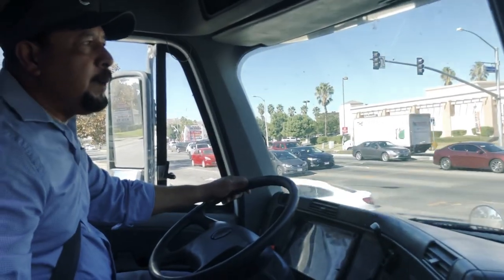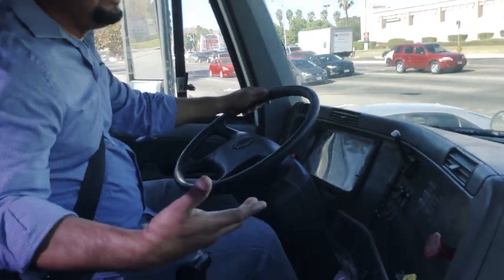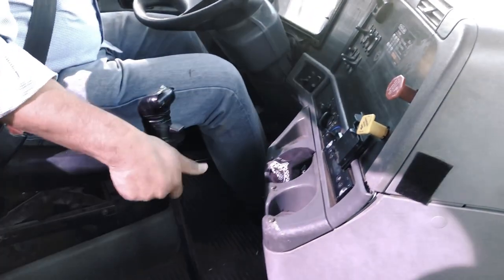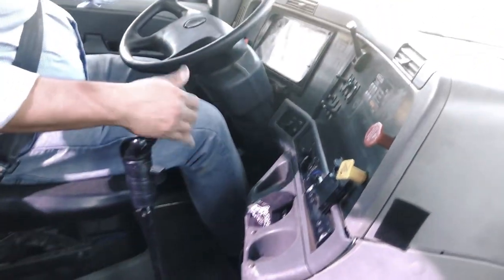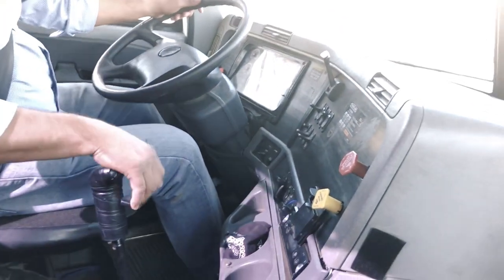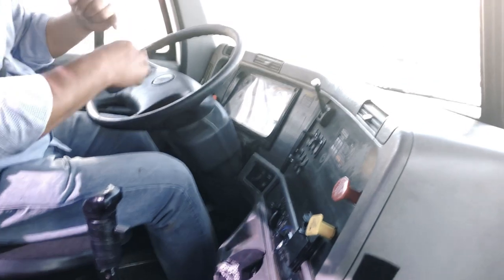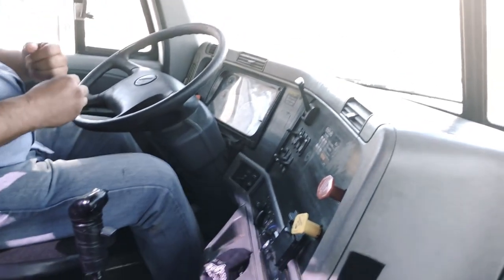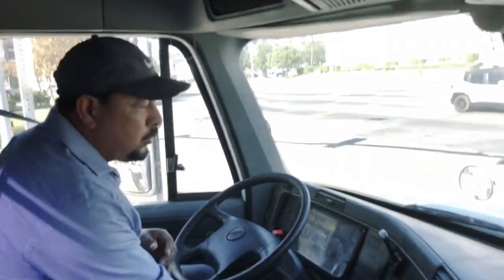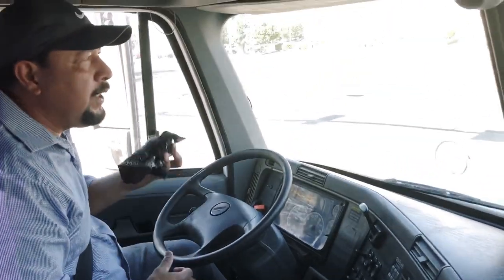A lot of people forget to do the switch and then they can't find sixth, obviously, because they never lift the switch up. Or sometimes when they're taking off, they forget to flip it down. So remember, tie a little something to your finger to remind you to flip the switch down or flip the switch up, whatever you need to do to remind yourself of that.